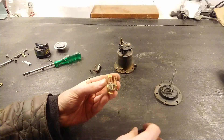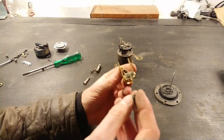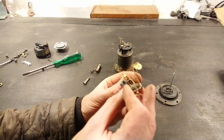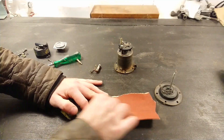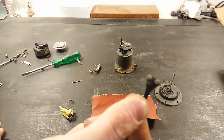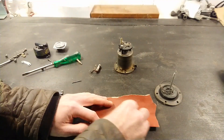Here's the points assembly. You can see they look very dirty. You can also buy these points brand new — if yours are completely worn out and the rest of the pump is fine, you can just buy the points. I'm going to get a little bit of fine sandpaper and clean them off right now. Now they're nice and shiny — we'll do the other half as well, and they're nice and shiny also.